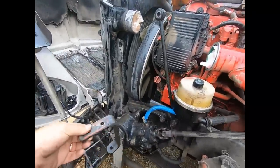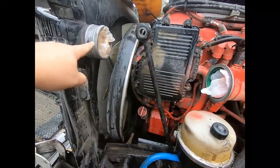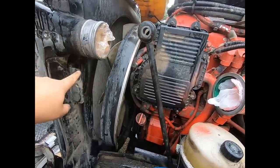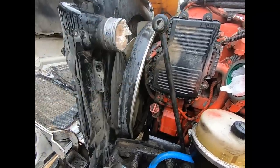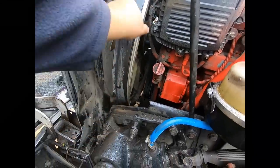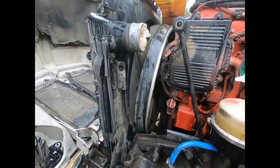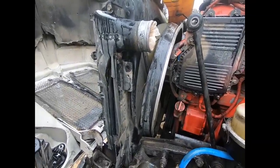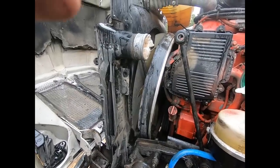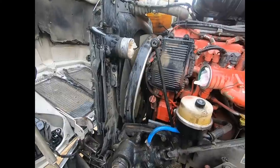We're back. There was one bracket on each side of the motor — we took those off. We took this charge air pipe off right here and plugged the holes so we don't get any crud in there. This torque arm, or the radiator mount, we just loosened that up and flipped it back out of the way. Down below there was a bigger one — we dropped that off and pulled this shroud back away from the engine. That all took about a half hour, partially because it's raining pretty good here.